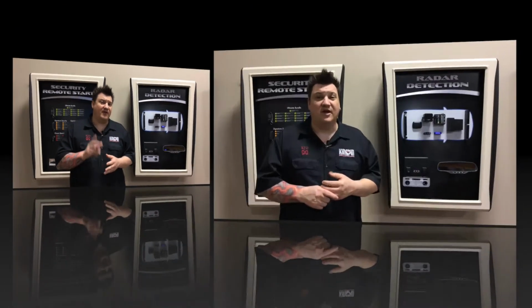Once we pull the cables inside, we've got a couple other components we need to look at. But before we do that, to talk about how those components tie in to each other, there's one more sensor we need to talk about. At the back of the vehicle, you typically have only one sensor. That is a rear laser shifter receiver sensor. And it's very important, just like the front, to make sure that it gets mounted level, so it's only 2 degrees up or down.